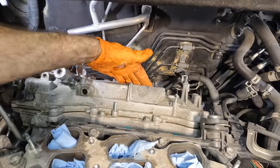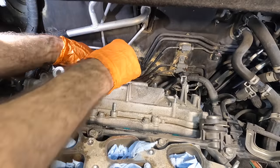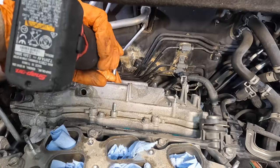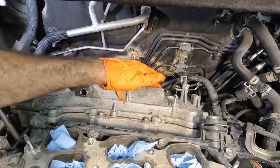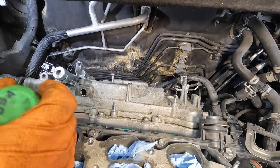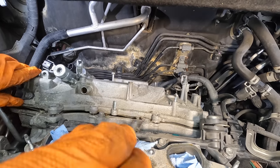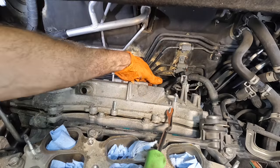All right, so I'm in here kind of feeling around, and I found what's hanging me up. There's a bolt right here in the center of this valve cover that's holding the unit down. Let's get that one out next. There you are. And what I don't know is if there's any others. But let's go back to giving it some pry action here. If that's it, it'll come free, and it did. See that? I knew something was hanging on to it. And what we don't know is if there's another one somewhere. It feels like there might be.